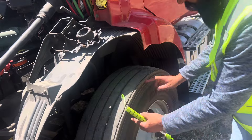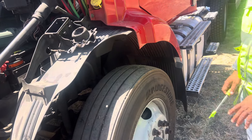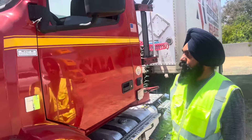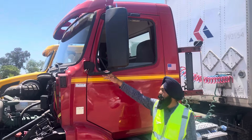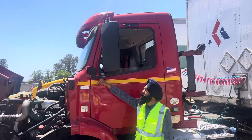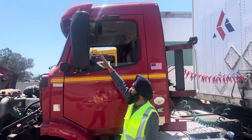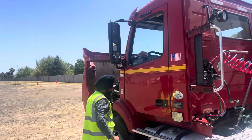That covers the front of the vehicle. Moving to the side of the vehicle: mirrors and brackets securely mounted, not cracked, not broken, nut bolts tight. Mirrors always clean, no illegal stickers, not cracked, not broken — adjusted just for my driving, both sides.